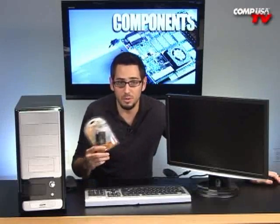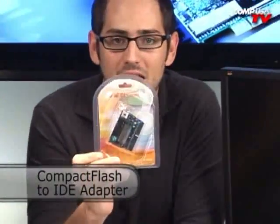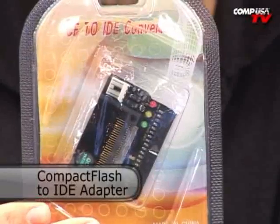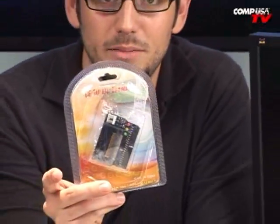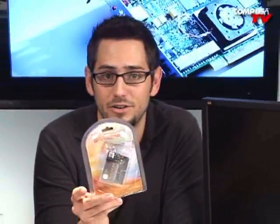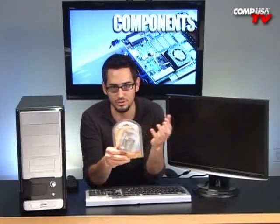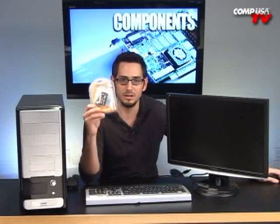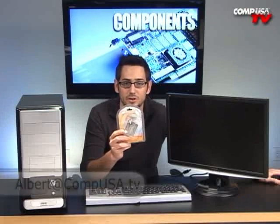For the people that are not going to buy this bundle but are still going to get the Atom with a really small case, take a look at this little device. This is a CompactFlash to IDE adapter. They also have a CompactFlash to SATA adapter. That lets you load your boot drive onto this SATA drive. You might ask, where am I going to stick all my media and ROMs and emulators? It's super simple to set up a little network. You get an N-Draft wireless USB card, stick it on the back — those go for like $30 nowadays, dirt cheap. It makes everything go really fast, really simple, and most importantly it's very small, so you can fit it in that small case.